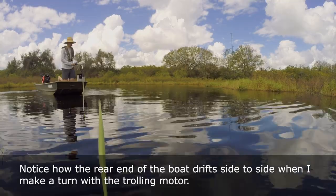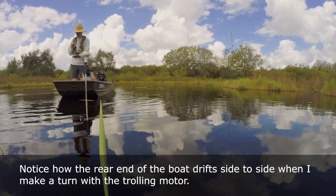I'll make it a little bigger than I need and then if necessary I'll just make a knot and shorten it. The perfect setting for the way I'd like it is for the skeg to be in the water but the prop up and out. If the prop's in the water you're adding extra drag, but having that skeg there will help keep the boat straight when you're using the trolling motor.